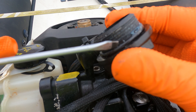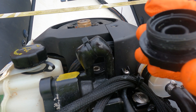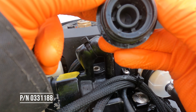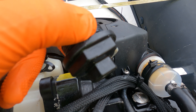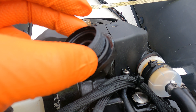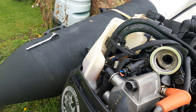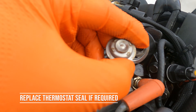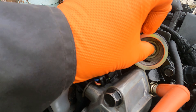After testing the thermostat, we've got a little o-ring here. We'll just pop this off the old cover and I've got a new o-ring which we can just roll over the top there. Now it's time to put the thermostat back in. The heat-sensitive material goes in first with the valve facing outwards, and we'll just pop that back in.